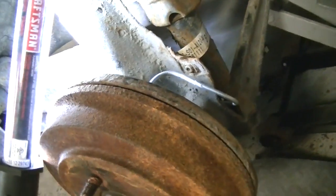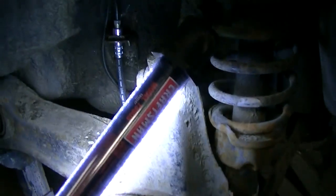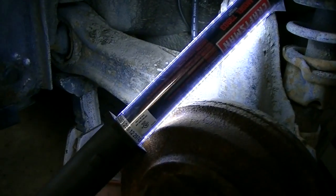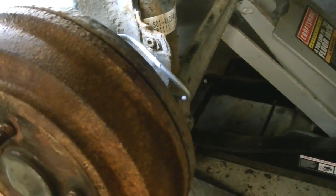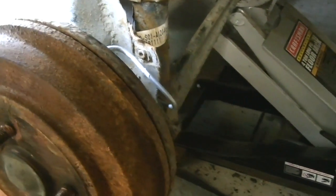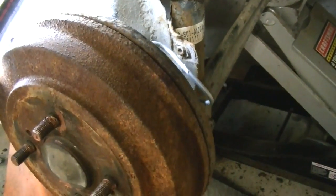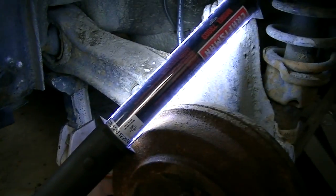Well, it's the next day — Monday morning. I've got a brake line to finish this particular run. Now that brake line on this side is brand new from front to back. Now I've got to do the same on the other side. The problem with the other side is it looks like you're almost going to have to drop the fuel tank in order to get it over there. So I'm going to maybe alter the path — see if I can't go on the inside of the other frame rail and get it far enough away from the exhaust so it doesn't put any extra heat into the brake fluid. The last thing I want to do is pull this fuel tank out of this car — at that point I think everything is going to go to heck. Who knows what's going to fall out. We'll see what happens.